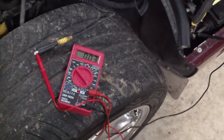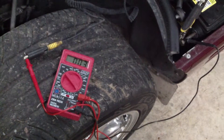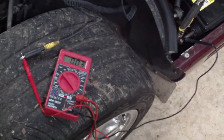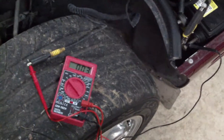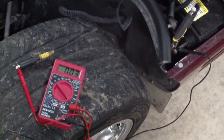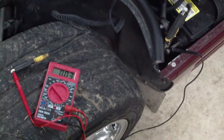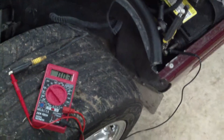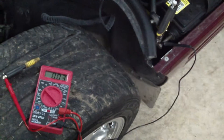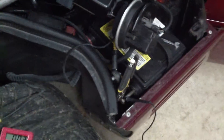If you let it sit for a month, or two months, yeah, the vehicle may not start — especially in cold weather. You really need to put a battery tender on it or disconnect the battery. Even a battery that's disconnected is naturally going to discharge. You've got to keep them charged up. If you're not going to drive the vehicle, disconnect the battery for long periods. If I park for more than a week, I throw the tender on it. That's the same battery that's been in the car since I bought it seven years ago, and I've always kept it on a tender.